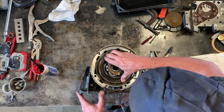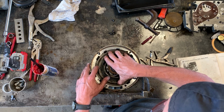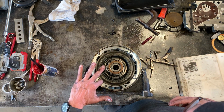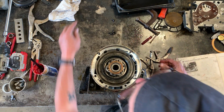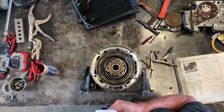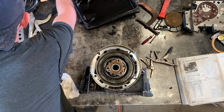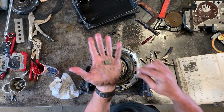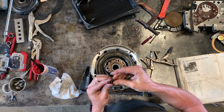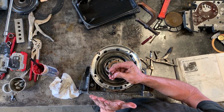But the outer element of the one-way clutch, which is this steel ring, has a single notch in it. And you're going to line up that single notch here with the lower left corner. And there is a block, a very special block that goes in there, which ironically I don't see right now. Here it is. Okay, here's the block. It's a special block. You can see it has a notch. That notch engages with the retaining ring or the circlip. So you want to put it in like this,